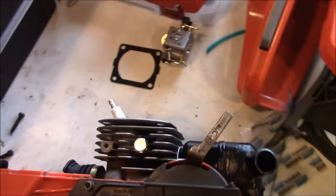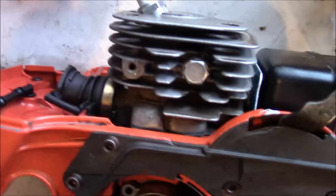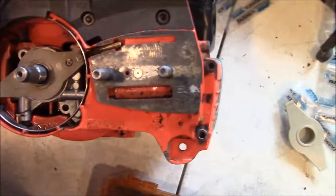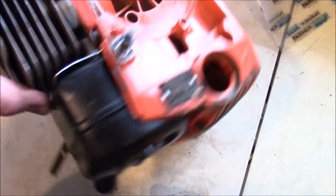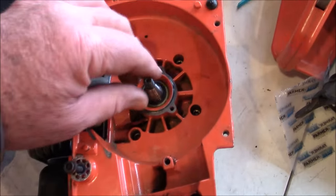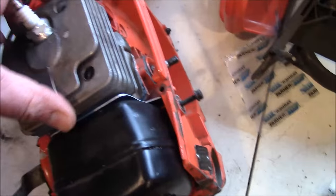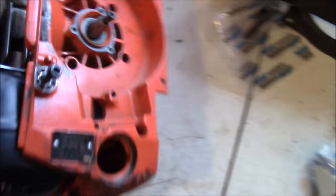The kinds of things I stay OEM with — for me, just because I haven't had time to try the others — are carbs, boots, clamp, crank and cases. I'm not speaking out of experience with the aftermarket versions, but I've got a supply of old cases and cranks and I've been using OEM. I think I would recommend sticking with OEM there; I've got nothing to tell me not to, but plenty of reasons why I should.